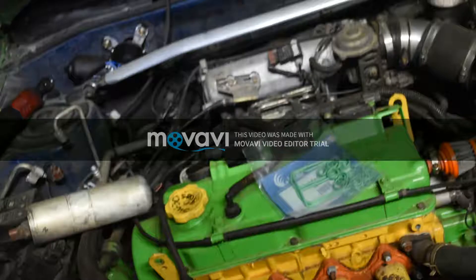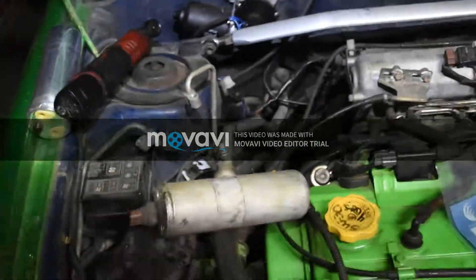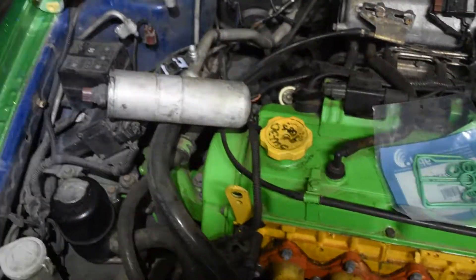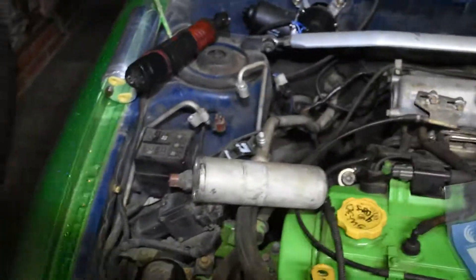So you just want to replace your o-rings, transfer your AC pressure switch, and install it. After installation, you just want to recharge your system and you'll be good to go. In this case I'm also doing the expansion valve and the compressor in separate videos. That's basically it — I hope you enjoyed the video, don't forget to subscribe and like. Thank you.